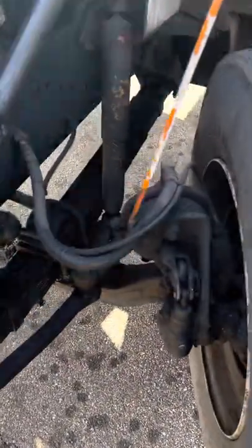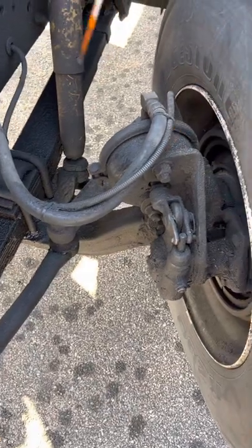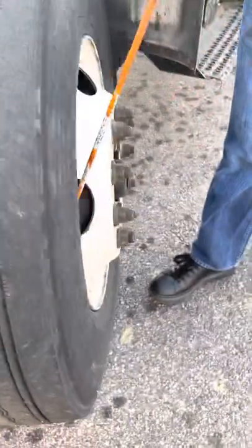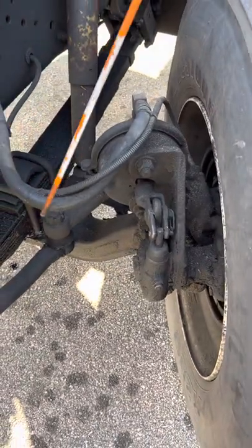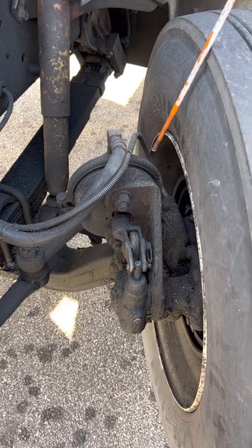When you move you can find the brake. Brake has another four points. We have brake hose, brake chamber, slack adjuster which is on the front here, and also brake drum. The brake hose is no cut, no crack, no fray, and also not leaking. And the brake chamber — no dent, bent, also not leaking.